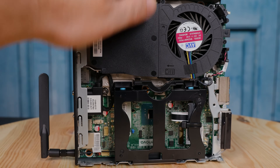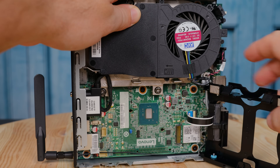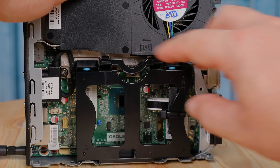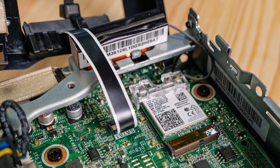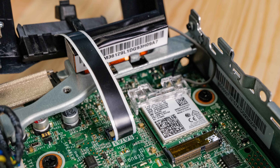To pull the tray out, you don't need any screws like you do with the HP system — you just unclip the plastic carrier and then you can put a drive in there. There are little pegs so you don't need to find screws or special rubber mounts. This is a SATA port, so you can put a hard drive or SSD, whatever you want. Note that if you bought a system without a 2.5-inch drive, you may not get this assembly, and there's also a special little ribbon cable that delivers both SATA data and power. So if you buy a secondhand system and want to put a 2.5-inch drive in here, that's something you'll want to find.